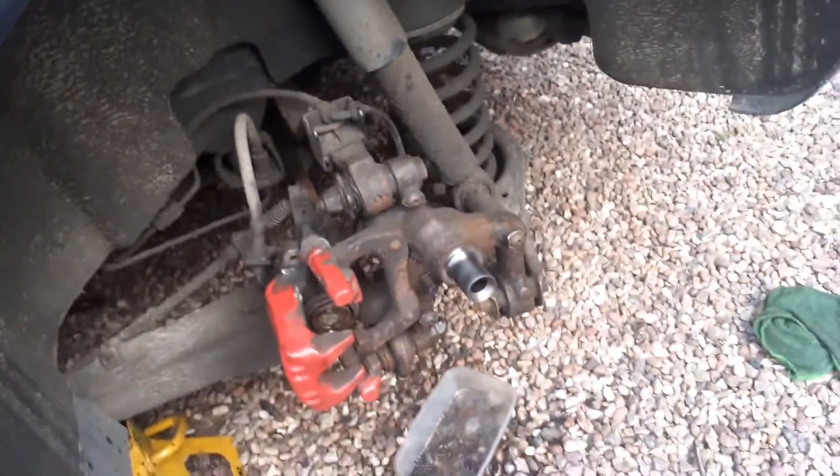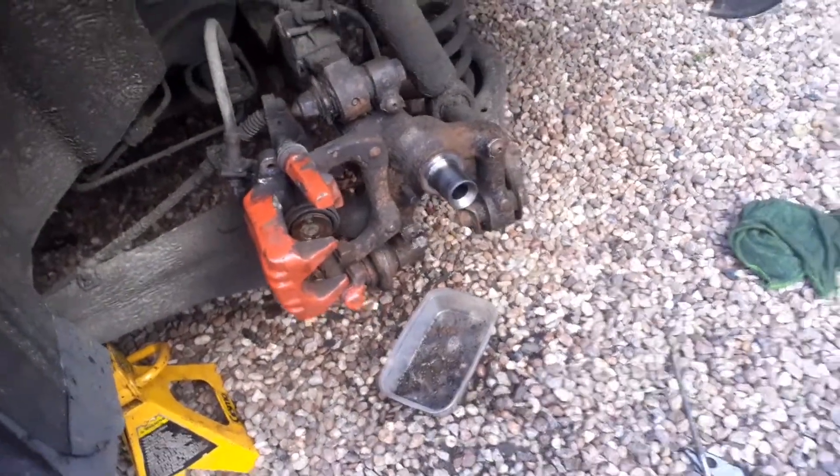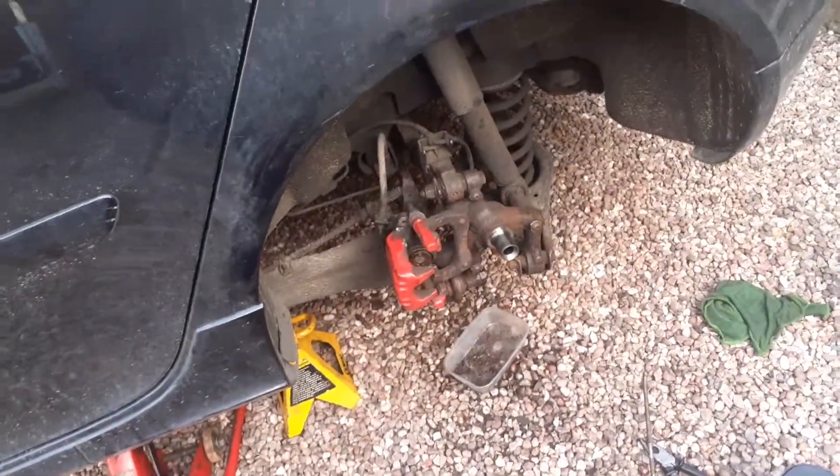Maybe that's what's causing the problem. It's all over the place, changing up on the DSG — comes from 3rd to 4th. Must be a speed sensor not quite detecting what it's supposed to be doing.